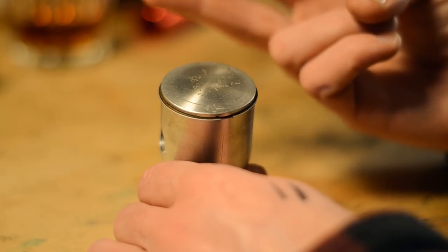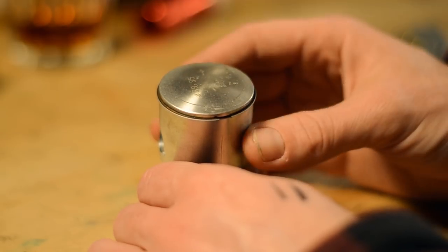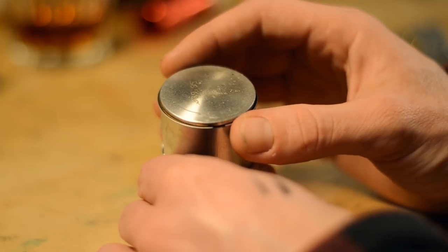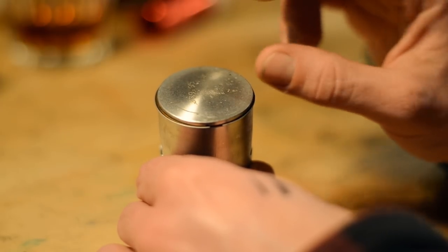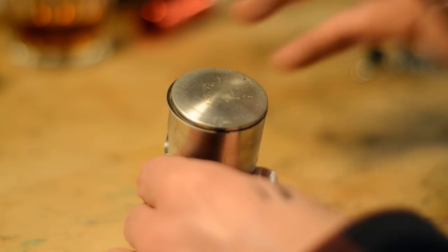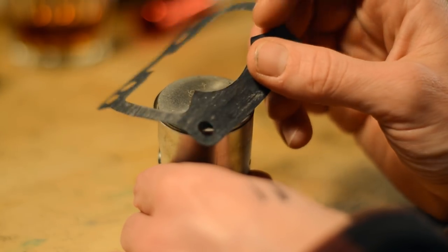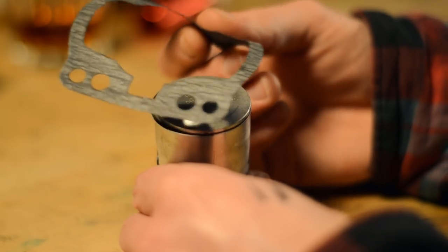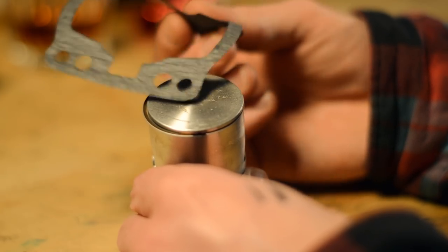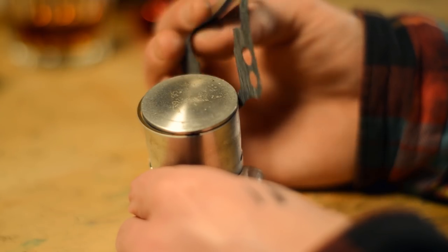This tells me two things. My squish gap is perfect, for RC fuel at least. And that if I want to rev the engine more than 18k, I will have to increase the gap by a little bit. As I've switched to gasoline, I'm going to add a second gasket, 0.2 millimeter gasket. I expect to gain 1000, maybe 2000 RPM with gasoline compared to RC fuel, and I'm pretty sure I can rev it past 18k without problems.